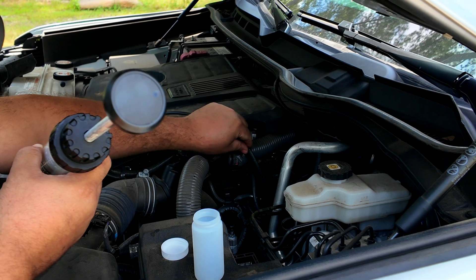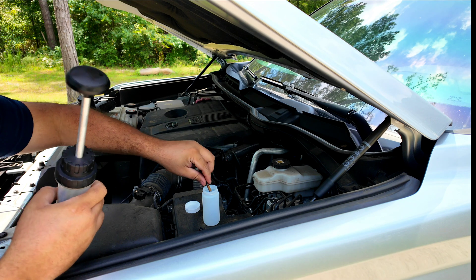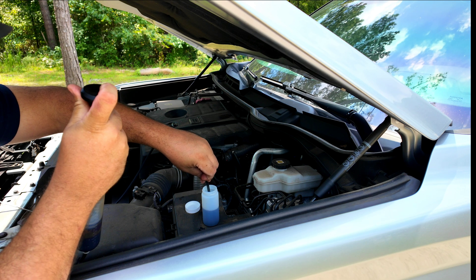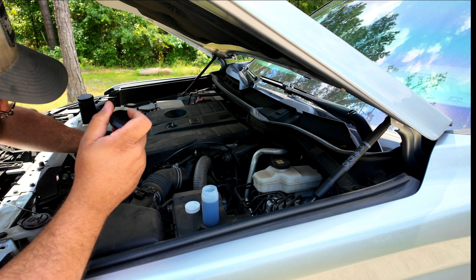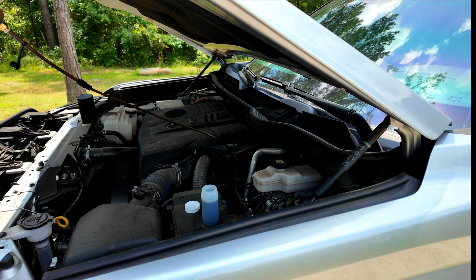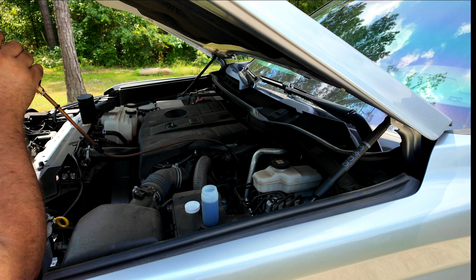Be careful pulling the tube out because it's a little warm, especially if you've had the engine running, and you're going to have a little bit of leakage. Put it in your container and squeeze it out. You don't have to fill the container completely up — right about there should be enough, maybe a little bit more. Then return any remaining oil back into the engine.